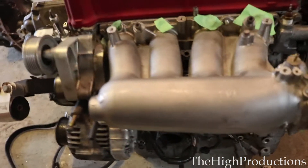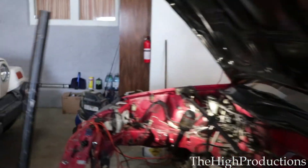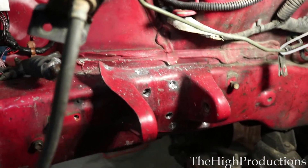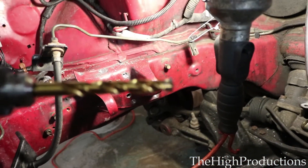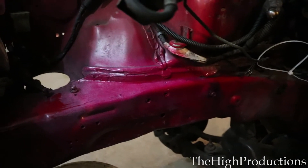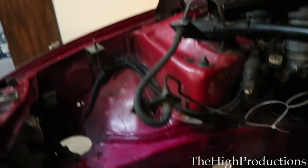So that's it — the fit is pretty good, not perfect, but I just want to show you what I'm doing right now. I am currently removing this OEM side mount to be able to put the K-series bracket on, so right now I'm drilling it. I finally removed the original mount, then paper-sanded it, put some primer, paper-sanded again, and started adding some color-matched paint.